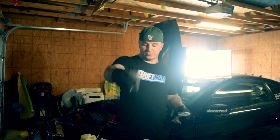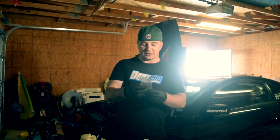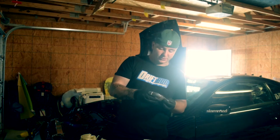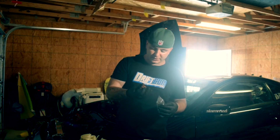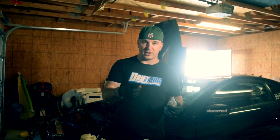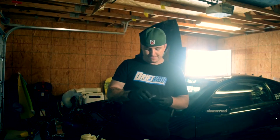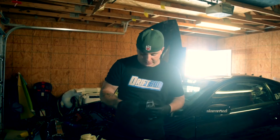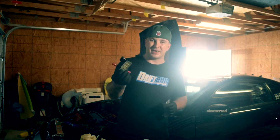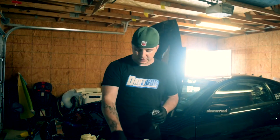Along with two fittings — I believe they come in black or blue depending on where you buy them — the kit also comes with a plug and pins so you can pin everything yourself without soldering, though you will need a crimp tool. It comes with three pins: power, ground, and output to the ECU. For mounting, I'm still figuring out how to mount it — I might buy a little mount, make one, or just put a strap around it.